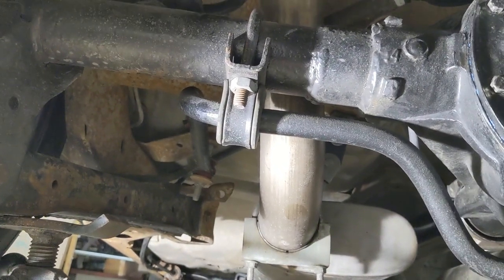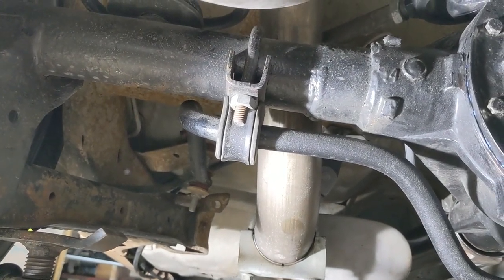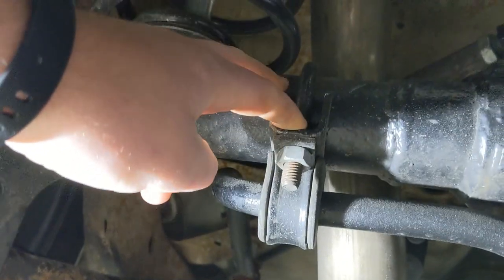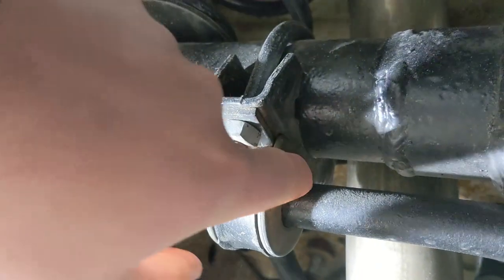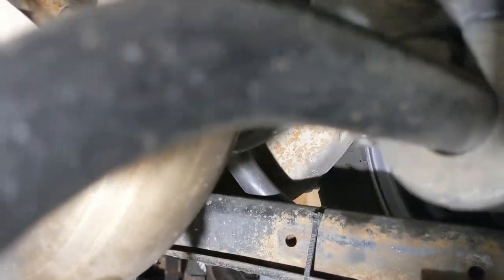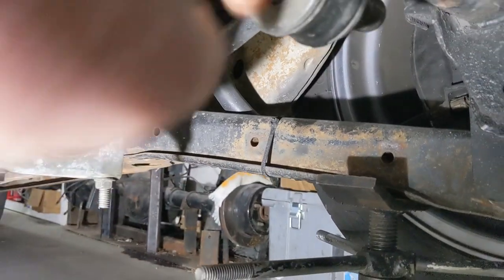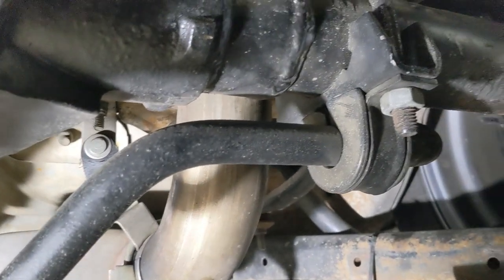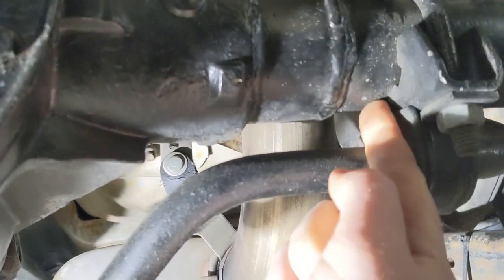This car, I cut like a 1.58-60 foot and it does not keep the car straight on launch. Basically what I did, I just grabbed the brackets from the junkyard and ordered up some new bushings. Something you might notice — and I think this is part of my problem — is these bushings are split on the top and there's kind of a gap in between them. I think as this car rotates over on the launch at the drag strip, that sway bar is opening up that gap.